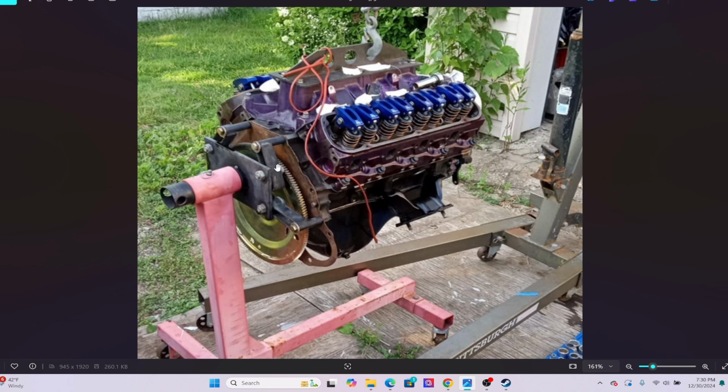The reason we check for crankshaft end play when you're building is because it wants to come out of the engine. Like, it'll go forward and back and so on. And what'll happen without that play is if it goes toward the engine, it can take your thrust bearing out, or your middle main bearing. And if it goes toward the transmission, it can take your transmission pump out of the front. So either way, not a good scenario.